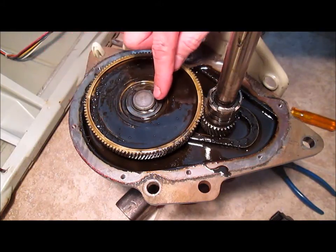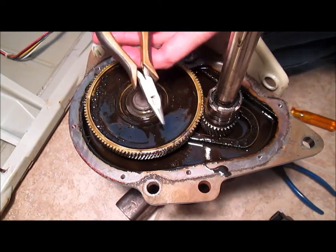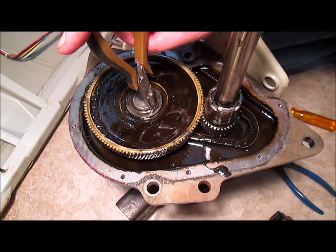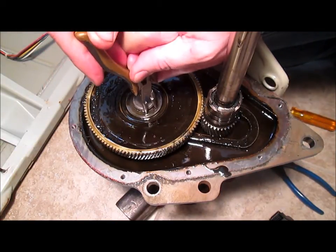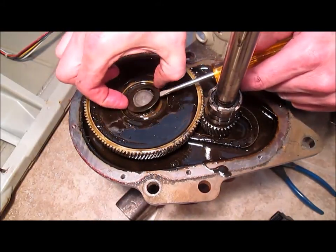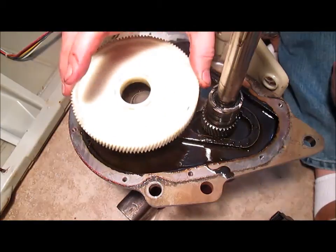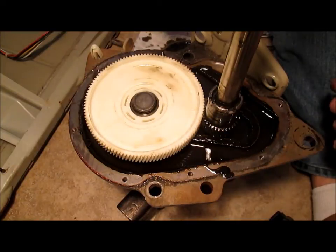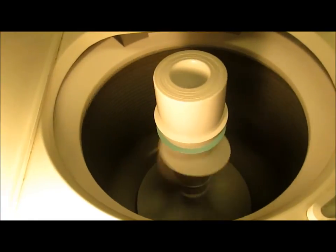To remove the gear, we'll first have to remove this little retainer clip. There's a specific tool that takes off these clips that look a lot like a tiny pair of long nose pliers. And it turns out that a tiny pair of long nose pliers, while not perfect, will get the job done just fine. Next, you lift off this metal washer. Pull your old gear off. Drop in the new gear that you got online for about 40 bucks. Button everything back up and your washer should be working fine. Thank you for watching, and good luck fixing your washing machine.